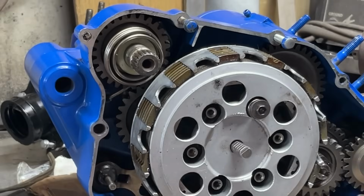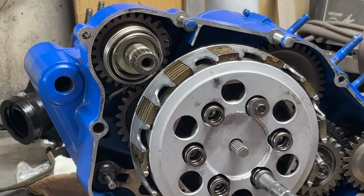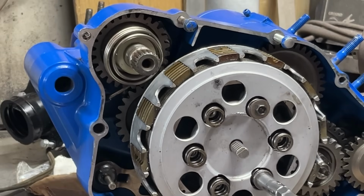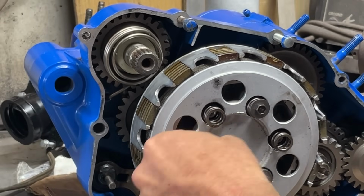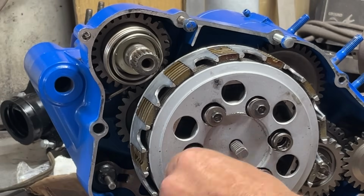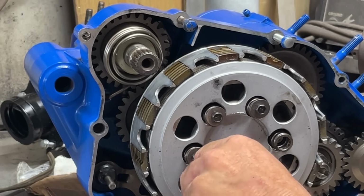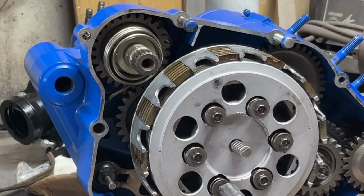You don't want to give the tower bolts too much pressure. It's very light torque on those things. You let them seat, you give them a little tiny ooga dooga and call it a day. The towers snap very, very easily. I've heard so many people complaining they're snapping towers off. Luckily, I'm very careful, and we'll knock on wood on that case. Haven't broken one in a long while.